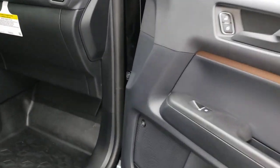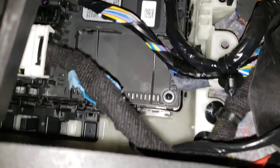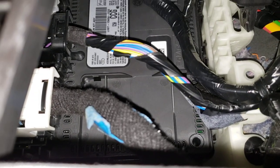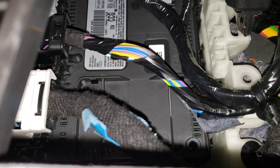We're going to go in the passenger side front here, underneath the glove box. There's a plate for the fuse box. You're going to want to lift up on that plate and kind of towards you. And then if you look up, there is a sticker right there, and in the lower left-hand corner is your key code.